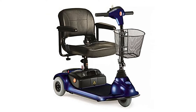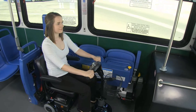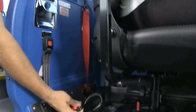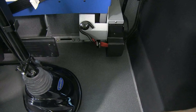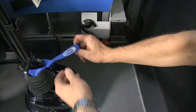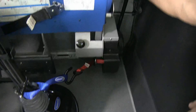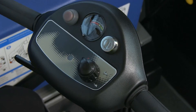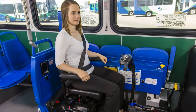For scooter securement, ask the passenger to move the mobility aid into position against the bumper and slightly away from the barrier. Next, pull the paddle handle to release the rear retractor belts. Pull out and secure each hook to the scooter. In challenging situations, use the blue webbing strap accessory — wrap it around a frame member and through itself to create an open loop to accept the hook. Apply front tension, turn off the scooter, and finally secure the passenger with the system's lap and shoulder belts.